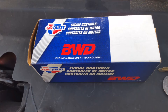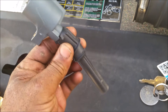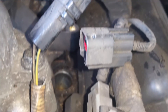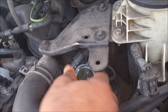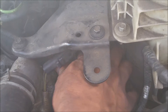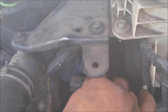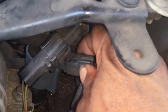We've got a new part — it's a CarQuest brand we got from Advanced Auto. Let's take it out and take a look at it. Put it right on into the hole. Put some dielectric grease already on the bottom of the boot, work it up in here, take our time — she goes in here nice and easy, don't force it. Line it up right, the hole lines up, and apply the spark plug wire on it.